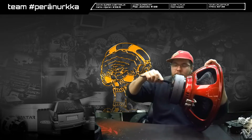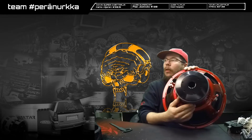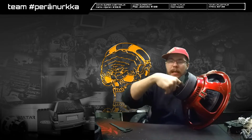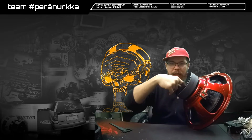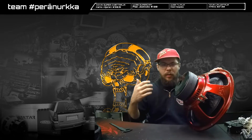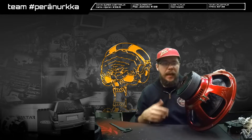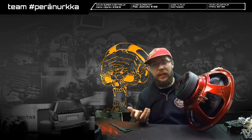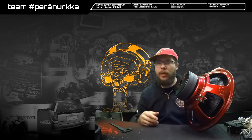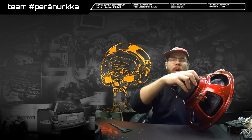We have a 10mm top plate and around 10mm back plate also. Back plate is only black. It has holes around and on the center, and inside here we have a steel mesh, which is a good or a bad thing. Now it prevents all the dust and metal stuff going into the voice coil, but after maybe 10 to 15 years, old subwoofers, like really old, from 2000 or something, now it's 2019, so about 20 year old subwoofers with these meshes, they are all rusted.